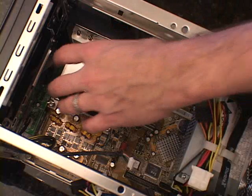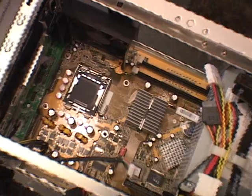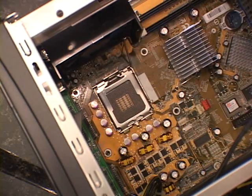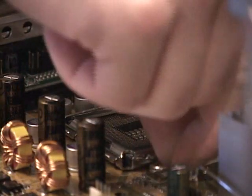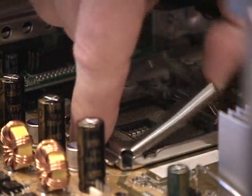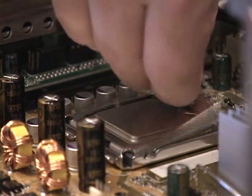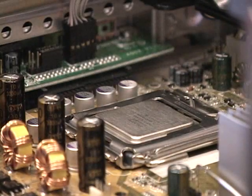The first thing you'll need to do is remove the CPU cooler assembly. This is done by loosening the four screws and simply lifting the unit. You'll notice there is a black protective cover over the CPU socket — you'll want to remove this as it is for shipping purposes only. Open the CPU socket and insert the processor, making sure that the alignment marks match. This is signified by an arrow and two notches on the processor and the socket. Now close and latch the CPU socket. It will be more difficult to close than it was to open, as you are now applying tension to the processor.